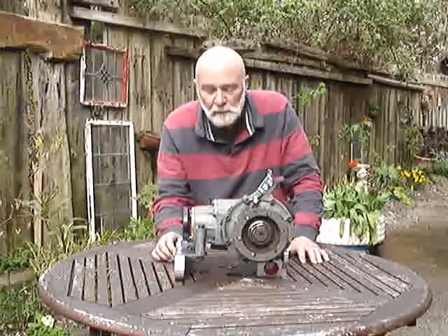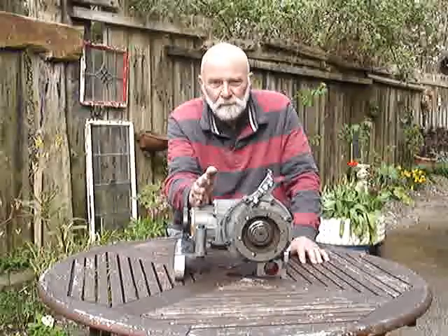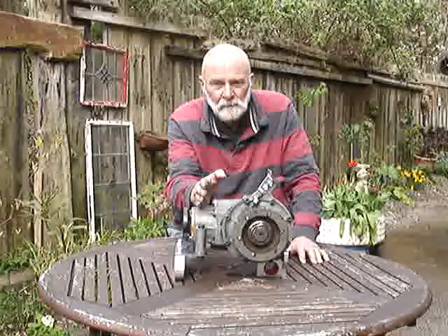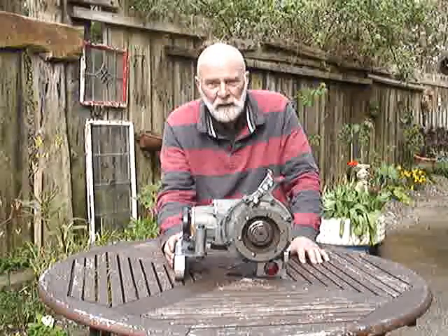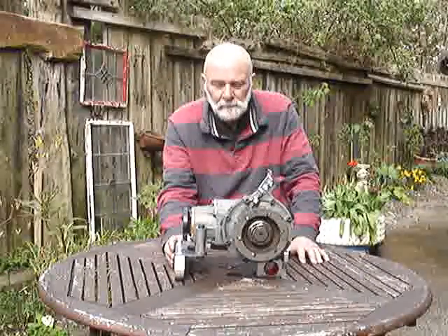You don't have to step it forward, but I step it forward because directly underneath these mounting bolts you will find the residue of the old mountings that were ground off with the angle grinder when the NVH kit was fitted. And you certainly don't want to be going in there with an angle grinder with petrol pipes close by. Far better just to leave them where they are.